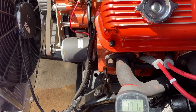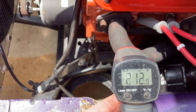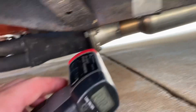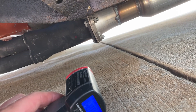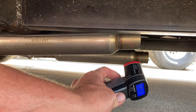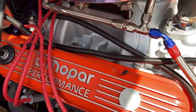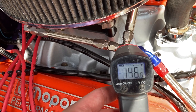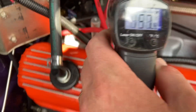Header tube: 212, 213. Collector right there: 275. All the way in the back: 126 and a half. Something else fun to throw in — I'm going to shoot this fuel line right here at the T: 148. Back here any cooler? A little warmer — 157 back there.